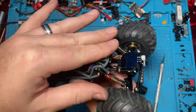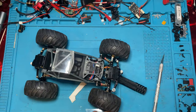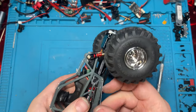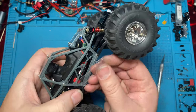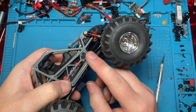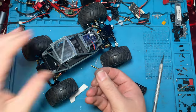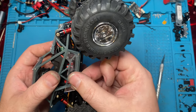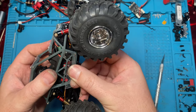All right, we've got the roof and the hood on. And now we're going to do the side panels. These side panels definitely have a tight fit when it comes to fitting up in between the tube chassis, essentially. So if you've already drilled your holes, you're going to definitely want to see where your holes need to align so that you can trim accordingly on the outside. And we're probably just going to use some sandpaper, and we're just going to flat sand it until this piece fits up in here and down on the bottom there. It's just a little off because, again, we overcut the size just a tad. So now we can just trim it down and make sure that all of our holes are aligning properly.